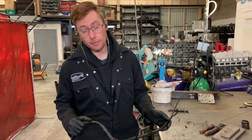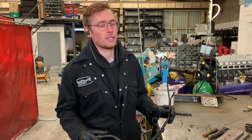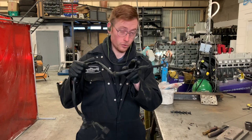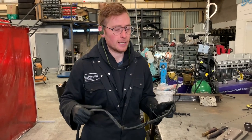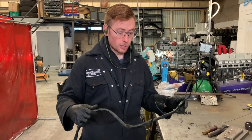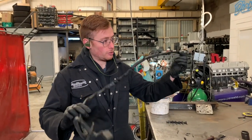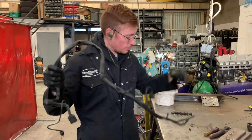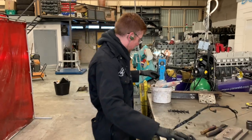There's a really easy answer to this, and that is simply connecting two connectors to one wire on here. Yes, it really is that simple, and yes, it really works. So that's what I'm going to do first. You take your 617 loom, take it off, and just take off the original glow plug ends.